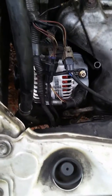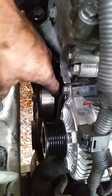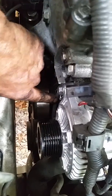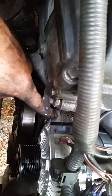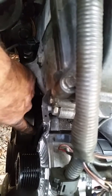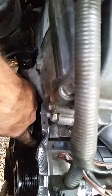Last step is to connect your battery and your belt. There's a wire that runs down here and a small metal bracket that that wire fits in — make sure that wire fits inside that little bracket, that little guide. It goes in behind this alternator bracket, right in between there. That helps hold it and keep it away from this pulley, because when the pulley spins it'll cut into that wire. So make sure that wire is inside that groove.